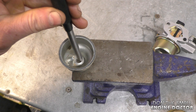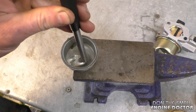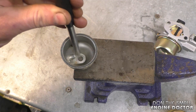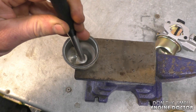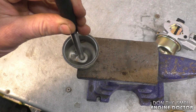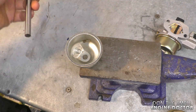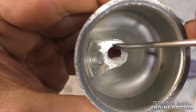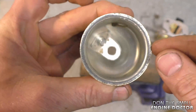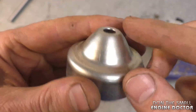For the repair, grab your hammer and pin punch, make sure the bowl is on a nice flat surface, and hammer it down. This will bring the bottom of the bowl even again. Make sure the entire surface is nice and flat — it will generally take you less than 30 seconds to do this. Now if you look at the bottom of the bowl on the inside, it's nice and flush, and the same on the outside.